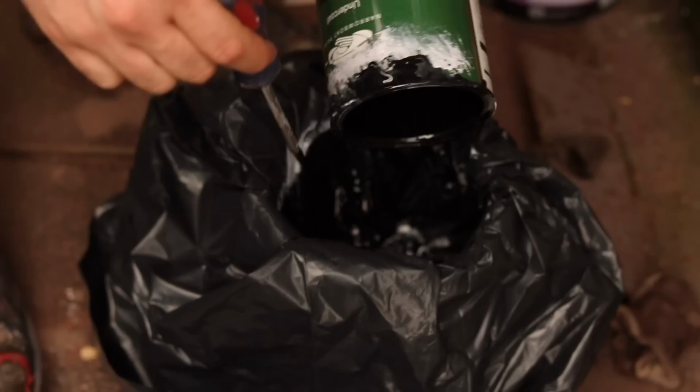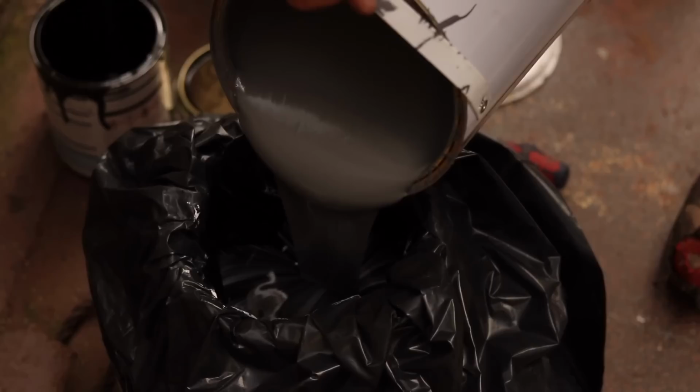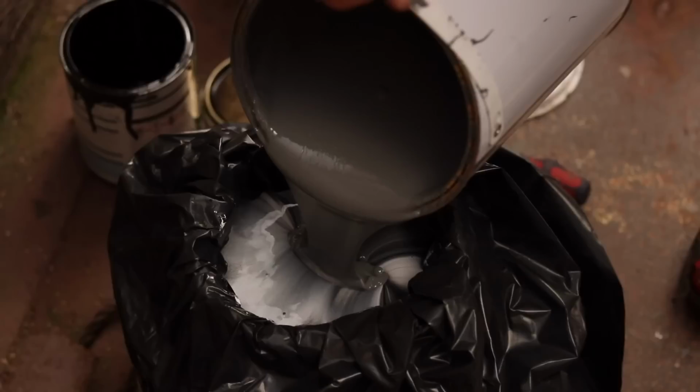So we spoke to the painter guy last night and he said that we can mix some of the undercoat gloss into the primer that we already had. So we've mixed that and we've just tried it on a small little section about this big at the front of the boat, just to see if it reacts or not. So we'll go and have a look in a second, because it's been about 20 minutes. So we'll know if it's reacted or not.